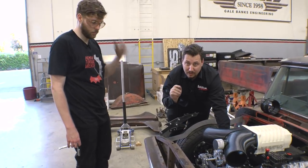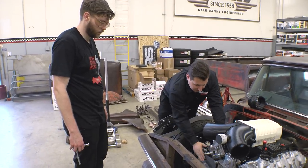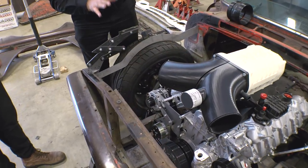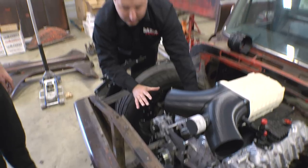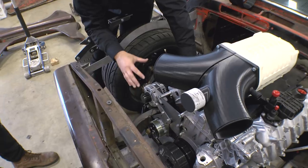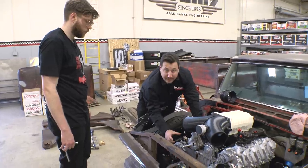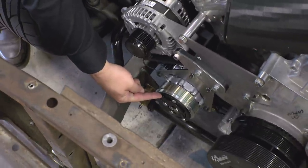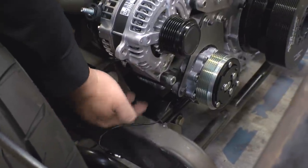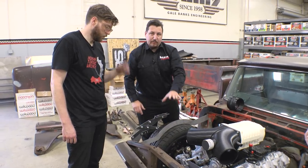We talked a while back about designing a new front engine accessory drive for our L5P, because we're putting our blower on. We've got our new crank pulley and we're going to position everything down low on Lockjaw. This is just for mock-up so we can go off to sheet metal with everything in the final location. Vintage Air sent us a mini-sanden air compressor, so that's mounted down here. The suction and discharge are popping out the side, so we should be able to route that nicely and probably hide it within the sheet metal work. Mocked up front engine accessory drive.